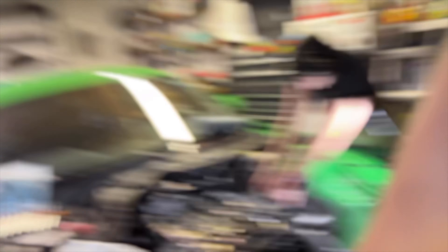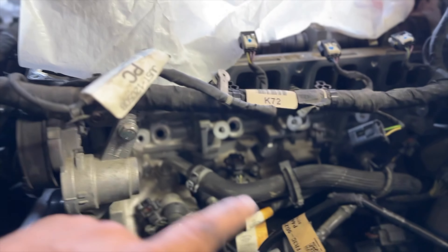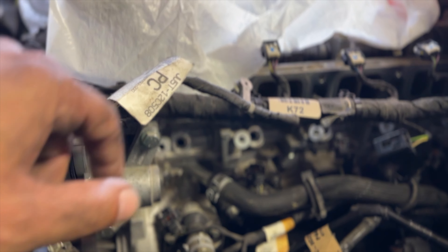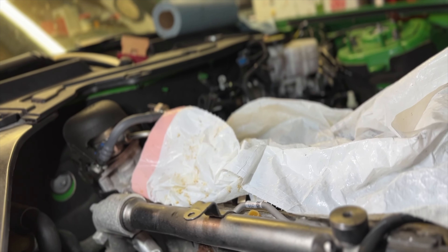Keep it out of a ditch — that may not have been the cause of it, but more than likely it was, though we're not going to say anything to her. About an hour and a half in and we have this side dismantled. Everything below doesn't need to come off. We've got the fuel rail out, the intake off on this side, and now we're getting ready to start taking apart the manifold, hoping we can sweep it out of the way without dismantling the whole turbo setup.